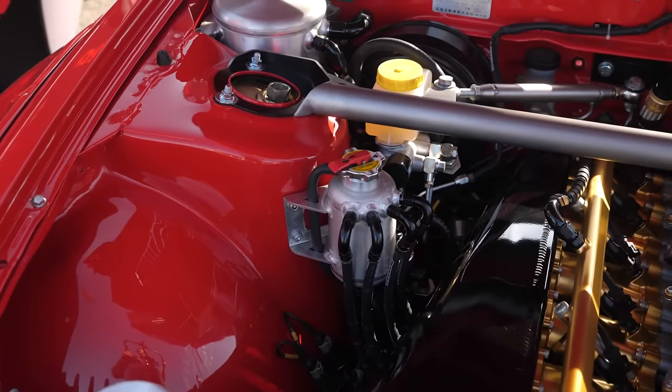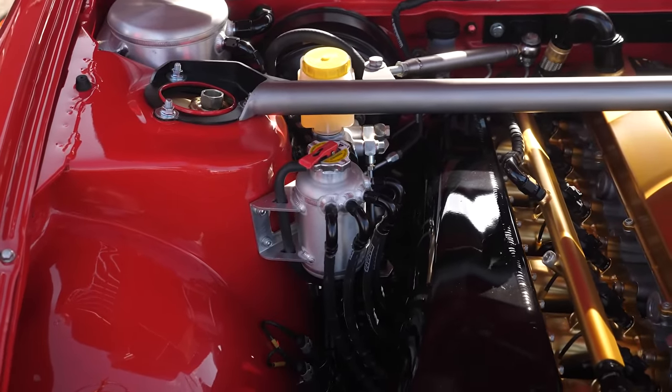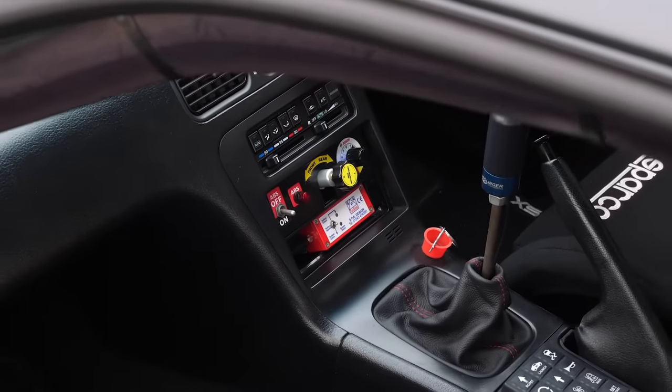Most race cars move away from a brake booster and dual-style factory master cylinder to a pedal box, with a separate circuit for the front and rear brake master cylinders. Is that essential when going to an aftermarket ABS system? I would say it's preferable - a pedal box and dual master cylinders is the system of choice to set things up optimally, but we have successfully installed the system into production-style braking systems, sometimes with an additional bias valve. In some categories the production braking system must remain, so it does still work.